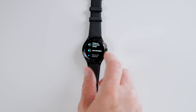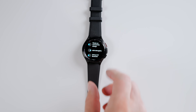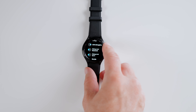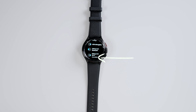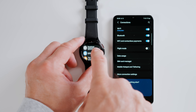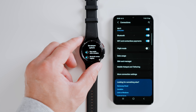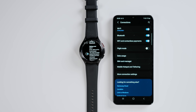Go in there and enable two settings. Number one is ADB Debugging — just press enable. And then Debug over Wi-Fi. If the latter comes up with 'unavailable', make sure your phone is also connected to the same Wi-Fi network, otherwise it will not work. This is very, very important. If both devices are on the same network, then it looks like this.